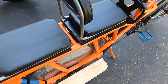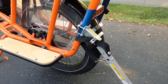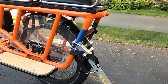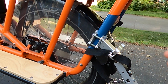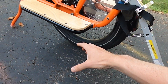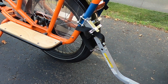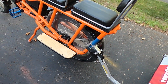A lot of people ask about trailers on electric bikes. We have a Burley and I'm going to be releasing a video on how that can attach to certain electric bikes. But here is an Allen Sports kids trailer, and my brother was able to modify this slightly and clamp it to the rear of the Rad Wagon 4. There were some modifications needed because this bar usually swoops around to connect right around here on a bike, so he had to drill some new holes and then bought an adapter to make this work. Some customizations are needed, but you can make it work on the Rad Wagon 4.